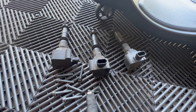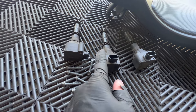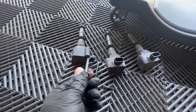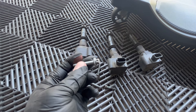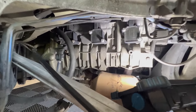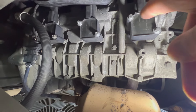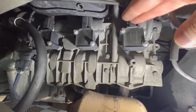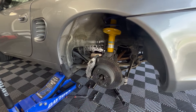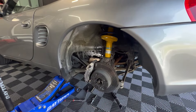The wobble extension actually helped for all of these as they're close to this body panel. Now we can throw the coils back in, screw that plastic component back in, and plug all of the coil wires back into the coils. I don't know the torque spec for the coil screws, but just tight is good enough — get these nice and snug. When you're putting the coil wires back on, make sure the rubber cover is out of the way. Push the wire back in, you'll hear a nice click, then move the rubber cover back down. We're all done on this side, so we'll put the cover back on, then the wheel back on, and move on to the other side.